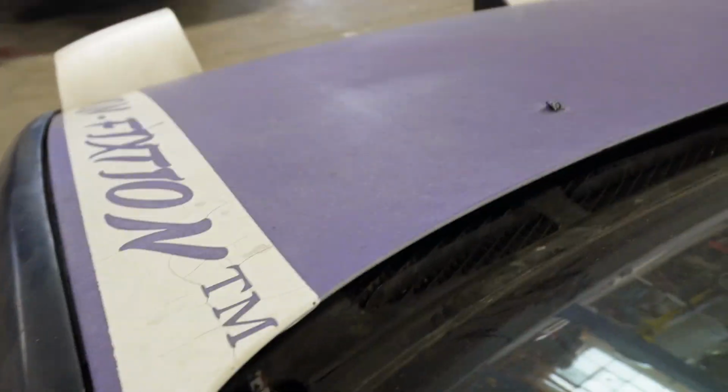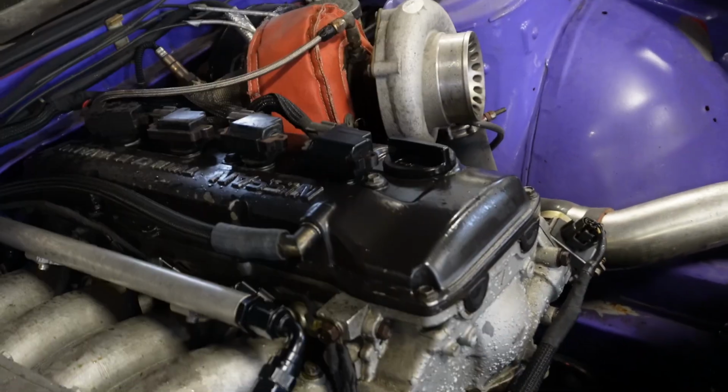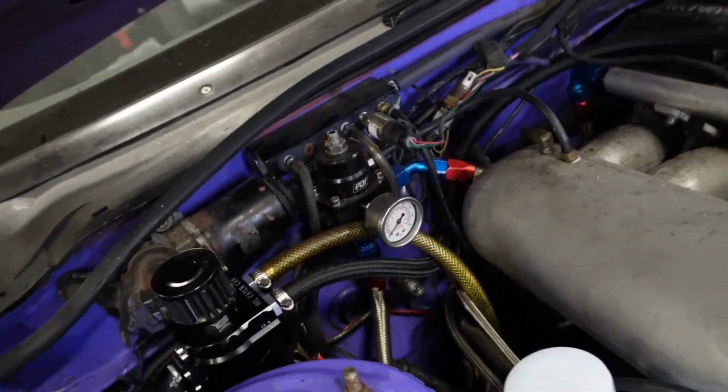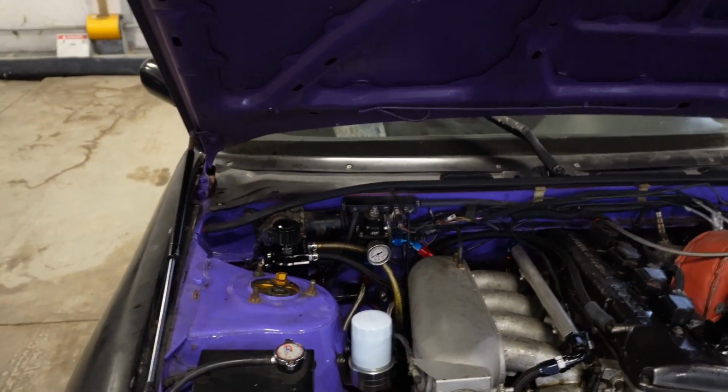Yeah, in the last video, it is still on the 800 horsepower setting, and I pushed some oil out of the breathers. I pushed it out the valve cover on a little filter that I had up there, and also on this hose that was just chilling in the engine bay. You can see, got the oil catch can on there.